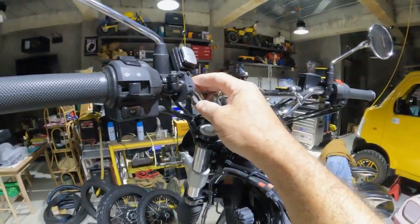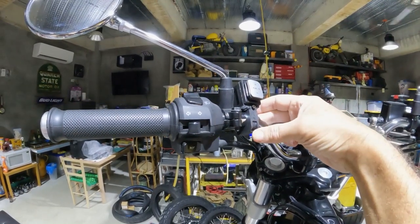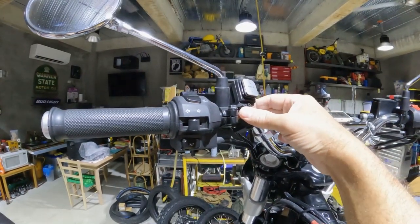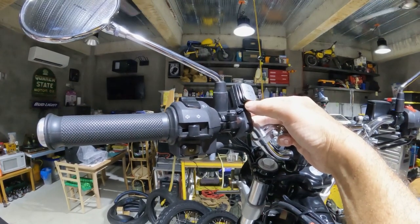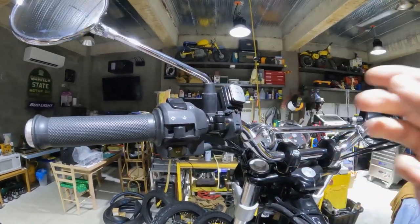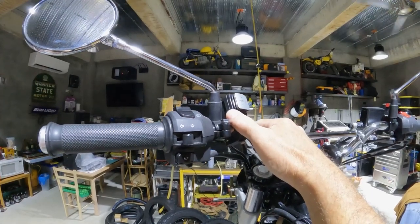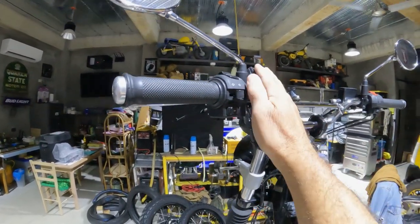This is the Pro model, which allows you to select up to ten different air/fuel mixtures — from zero to ten, where zero is very lean and ten is very rich. You can adjust this on the fly depending on your riding conditions and altitude. Level three is back to stock. They recommend steps seven through ten to maintain a safe air/fuel mixture. Unless you're at high altitude, you don't want to get too lean.